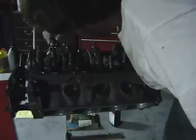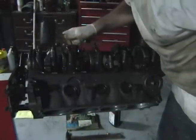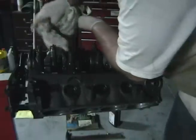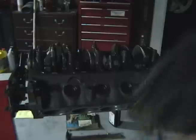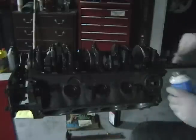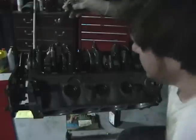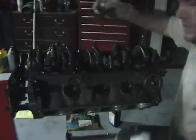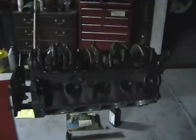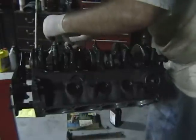I'm going to put that on, then take my rubber hammer and give it a very light tap just to get it seated. Now wipe off all the excess. Now I'm going to put a little bit of my ARP fastener assembly lubricant — I don't need much, just a little bit on the thread, just on the tip. Work that in.